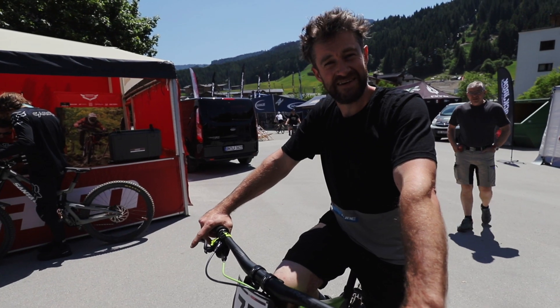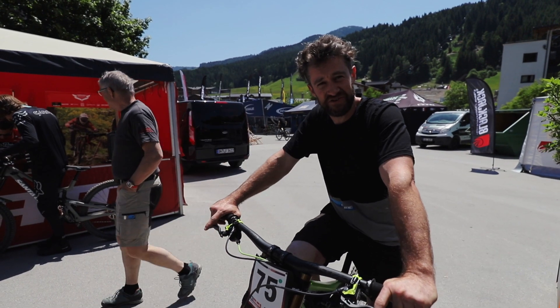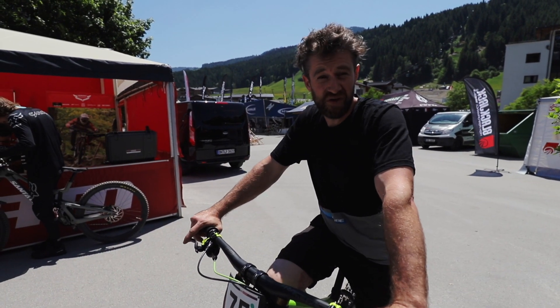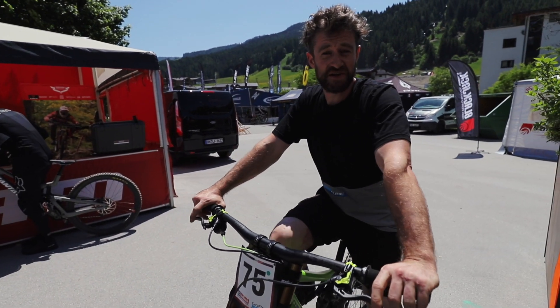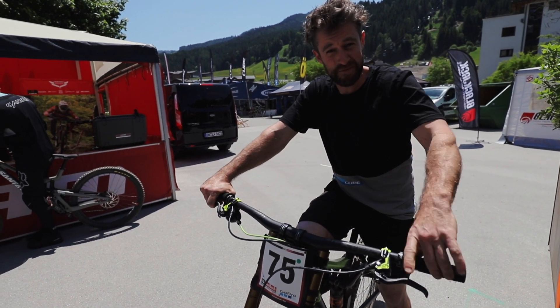Loris just came in, making some changes, trying to get him happy. The temperature is probably 15 degrees warmer than it was in Fort Williams — we're at about 27 degrees — making everything feel a little softer, a little smoother. So we're closing some compression, closing some rebound, just little adjustments. The boys are loving the track so far — it's cutting in real nice, all those new sections, everyone's really happy. Jordy has kept it dialed for us.